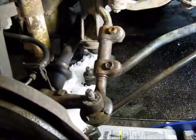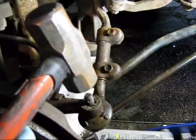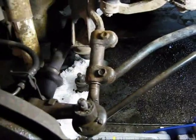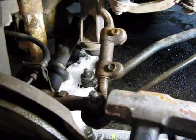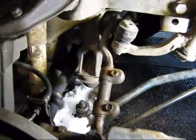This is probably going to be laughed at by a few, but just in case anyone ever tries this: don't try and get ball joints, tie rods, anything that's a press fit like that, by hitting on the top of the stud. It's a waste of effort because the shockwave travels down and doesn't loosen. Instead, hit right there on the side, and that'll get them loose every time. In fact, I'll even do it while we're doing this.